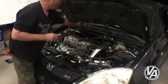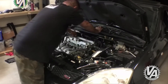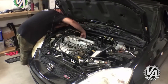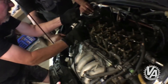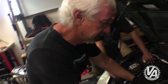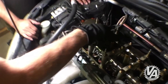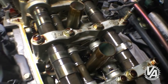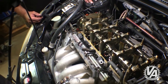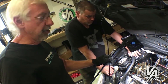We're going to take his cam out and put this one in, and we're going to try and do it without taking the timing chain off. On his particular car, it's not the four-cylinder — it's actually the second cylinder. You can see how chewed up it is, right there at the top of the lobe. Really kind of garbaged out. The others look okay. The intake cams all look fine; usually those aren't a problem. The SI part number is actually the same as the CR-V cam, so that's why we chose that particular cam.